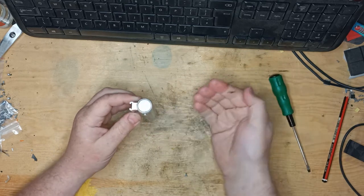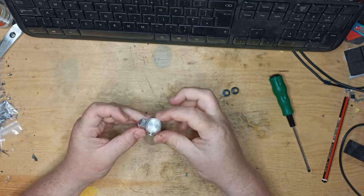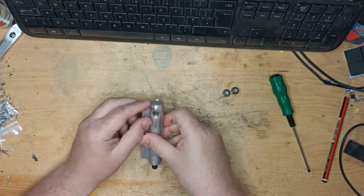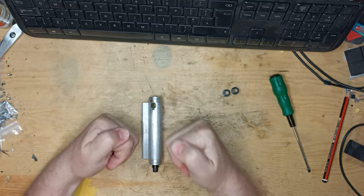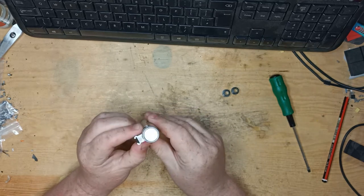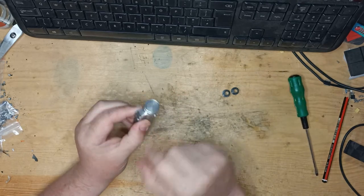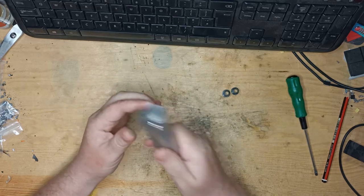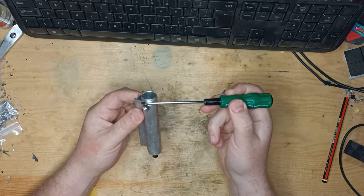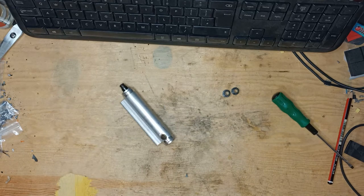When they make it, they put that bung in. This must stick out more, because that entire top there is aluminium — this entire unit's aluminium. It seems to have been crimped down back onto that bung. It's possible to perhaps get in there and pick it out, but we could take a small Dremel or similar type tool and simply cut this entire section off. So that's what I do.